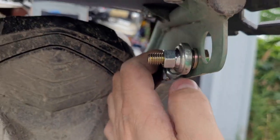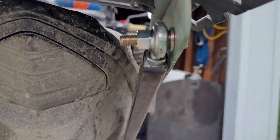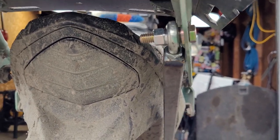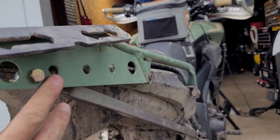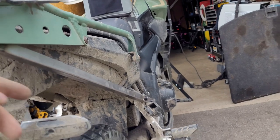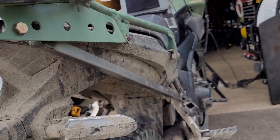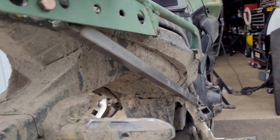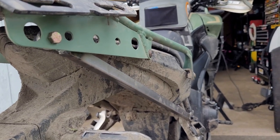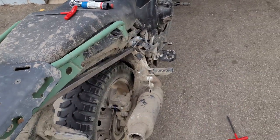The eye on the end of this might be a little overkill, but I had them laying around from when I built sidecars, so I put that in there just so I had perfect adjustability to where I need it to be. I could have put a plate on here like I did down there and welded this to the plate while it's on the bike, but I hate doing that because everything has a circuit board in it now — including my tail light — and I'm worried I'm going to fry something. So I haven't done any welding on the bike; this has all been off-bike welding.